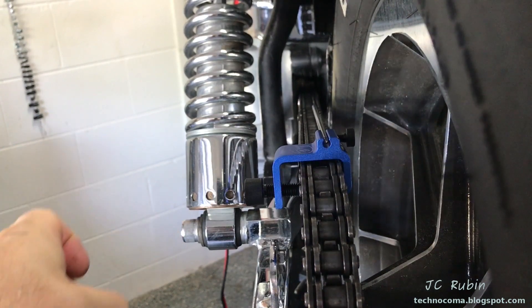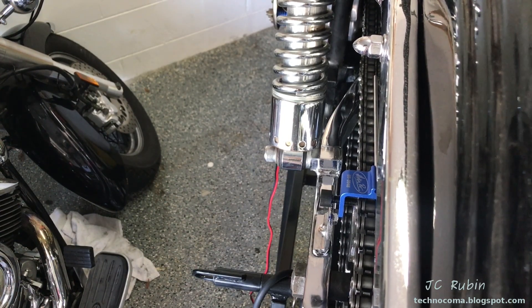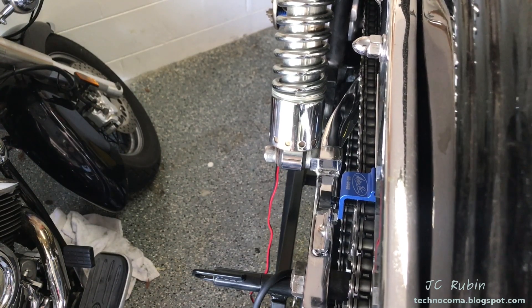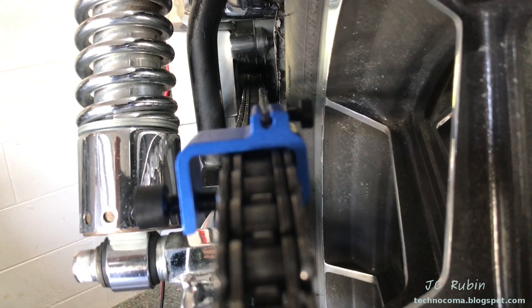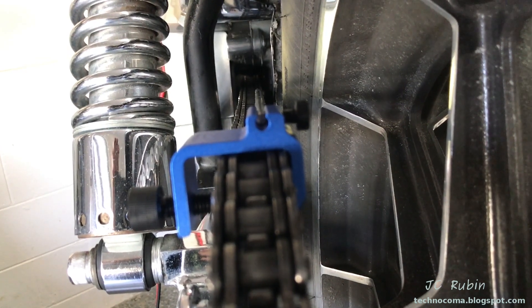While viewing the tool and working one flat at a time on each side, I'm going to be tightening one and loosening one to rotate the rear axle. The left side gets one flat loosened, the right side gets one flat tightened. I'll reevaluate and repeat until it's aligned. I overshot it — it's now pointed to the right — so I reverse the process: the right side gets one flat loosened and the left side one flat tightened. Views from a camera can be subjective with parallax distortion, so it's important to be lined up directly behind it when looking — it's easier with the naked eye.